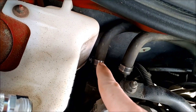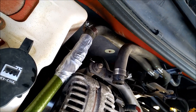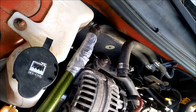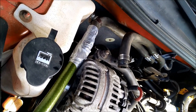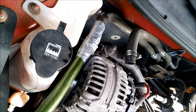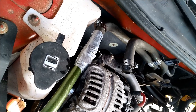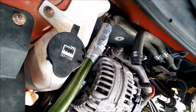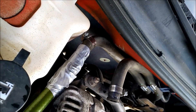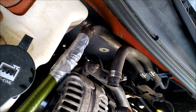We're putting the hose onto the outlet side, which is the one on the left. This is what it should look like. Now of course this is an absolutely bad job — it's going to leak — but it doesn't really matter because you only need to hold it together for a few seconds, just to flush enough water through to fire the crud out the other side. The heater core doesn't require a lot of pressure, so you're supplying more than it usually gets. Because we're going in reverse, it's going to back-drive all that crap out. All you need is another person to turn the water on and you're good to go.